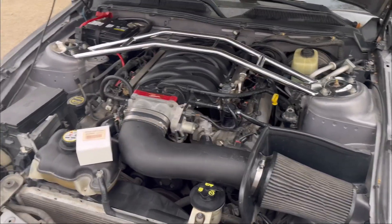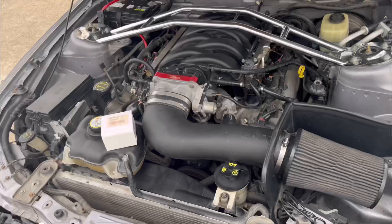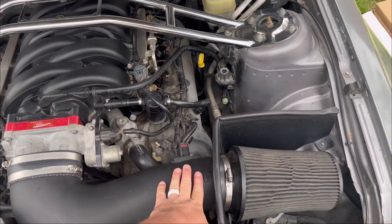That could maybe be related to this. I'm hoping there's not a deeper issue, but anyway, just for the mass airflow sensor that's like a 30-second job — very easy, two screws, Phillips head screwdriver, and that one pull tab that we had to remove.